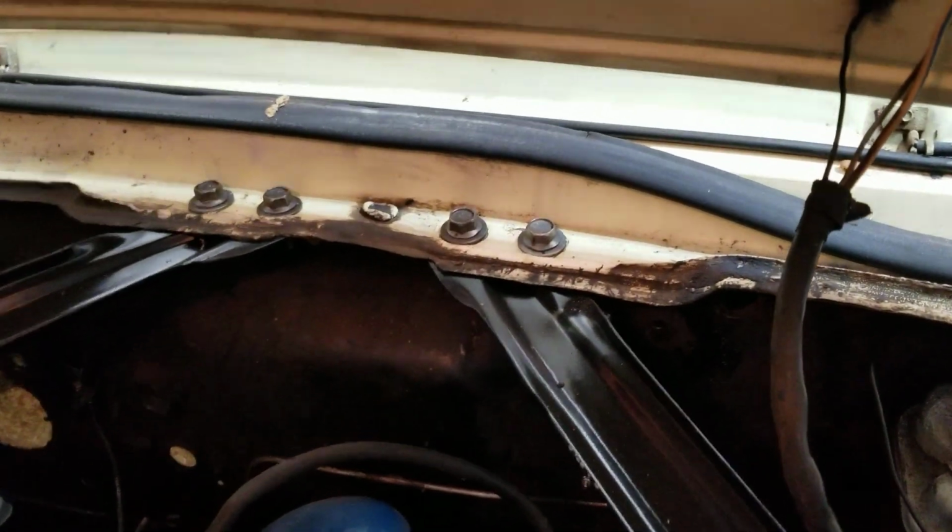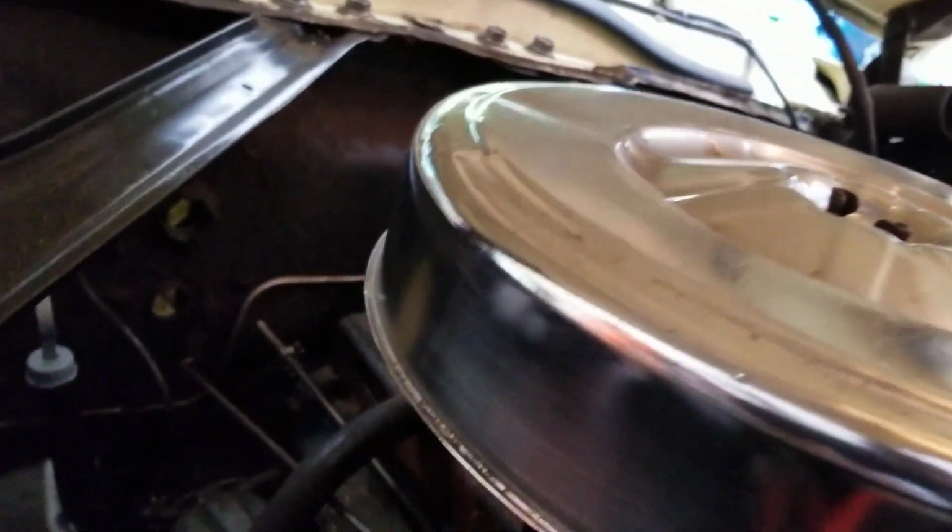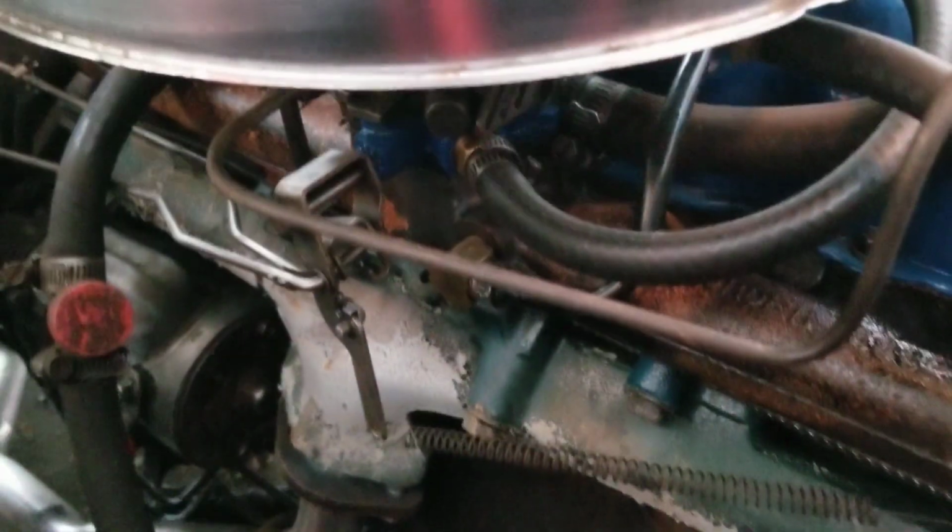And like I said, I think we're going to end up having to run the wire along the back over there, and then come up over here. And then all of this mess that's down here, that goes to the alternator and up to the solenoid up here, is going to get replaced. Okay. I think we can still use the same block ground for the alternator that we were using before. On that, also looped into here, I think. Yep. So you follow up here.